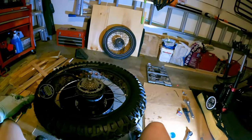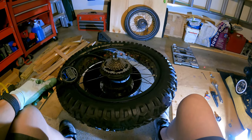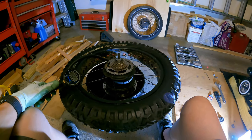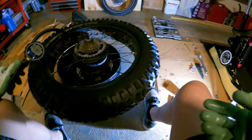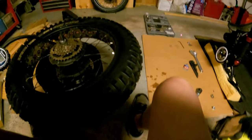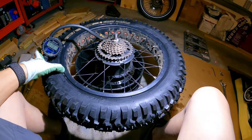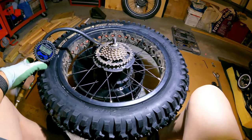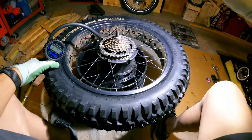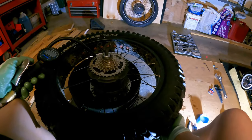I'll go ahead and weigh the two tires, give you a difference in weight, 2 seconds after I seat this one. We're at 50 PSI. I'm gonna check to see if it's seated. Now you see this, as long as all this is in, it might not even pop. If you have soap and it fits perfect, it won't even pop. As long as that nice bead around there is nice, usually you're pretty golden.